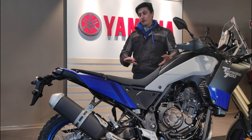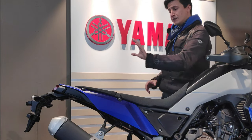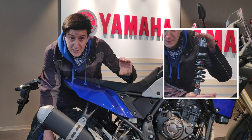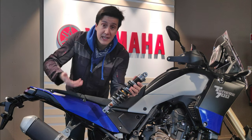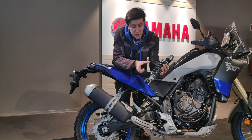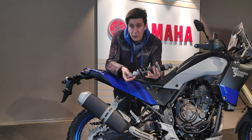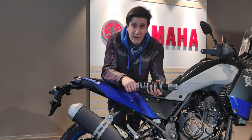Look at this perfectly fine motorcycle. What do you think would happen if I put a considerable amount of weight right here? That's right — the tail of the bike would squat down because the whole shock is being compressed. This happens because the spring on your shock failed to sustain the extra weight you applied on the motorcycle, meaning you're already using half of your suspension and you didn't even turn on the bike. There must be around 3000 reasons why this is bad for your motorcycle's performance.